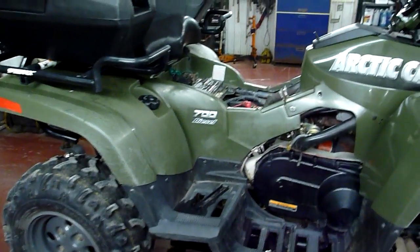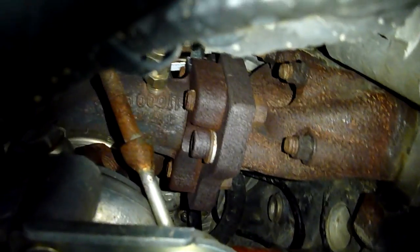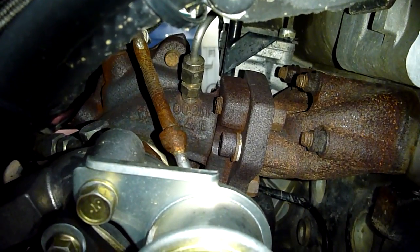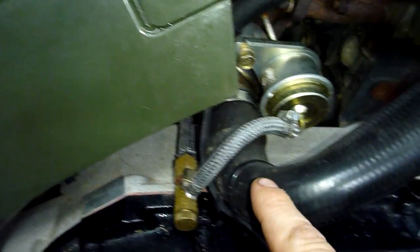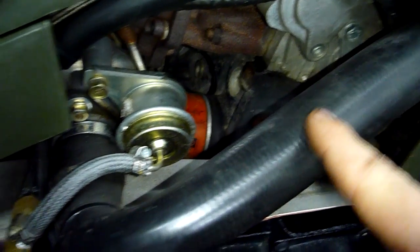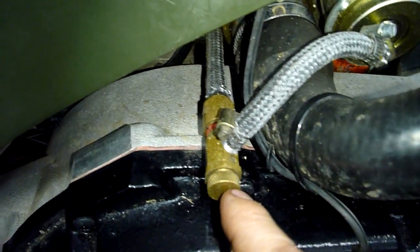On the right side of the motor here, you see the turbocharger, you see the wastegate, and you see the exhaust manifold with the adapter that I made. You can also see the probe on the left side to measure the exhaust temperature. On the top, this is the oil line that feeds the turbo, and on the side here is the inlet air that comes from the air filter. Here is the wastegate controller — that controls the boost, and it's mechanical.